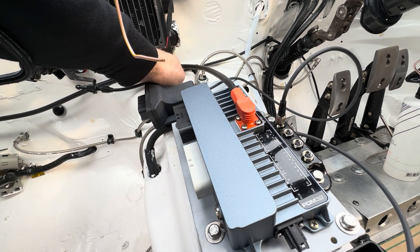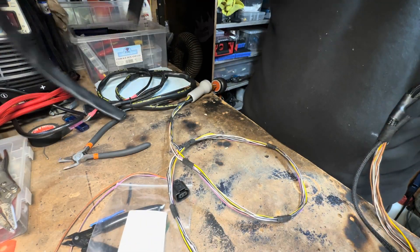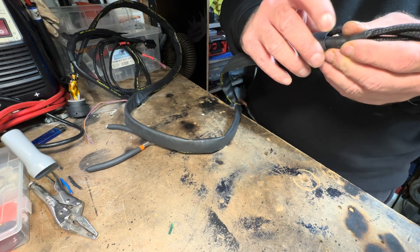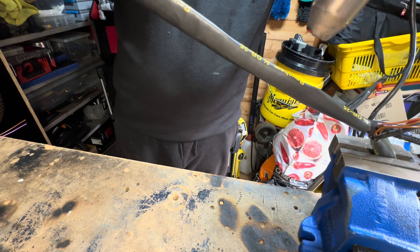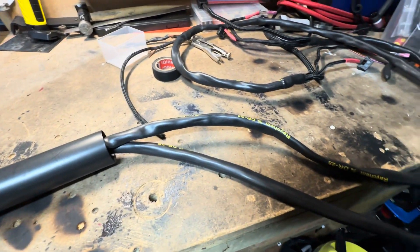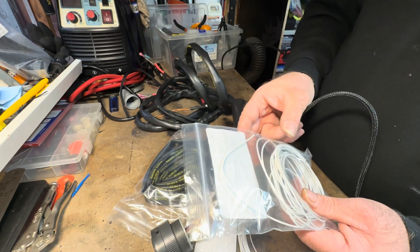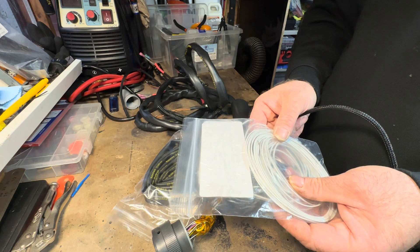It's time to go back to the shed and make up some of these wiring looms. I'm just going to thread it through like that and push it through. Okay, so that's the DR-25 on, not recovered just yet — got to recover it all down. So that's almost done. That's the engine bay loom for the front lights, horn, and so on. There's a sleeve you can go over there. One mil wire, and then splice off to 0.5 mil for the 5-volt reference.